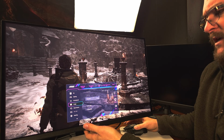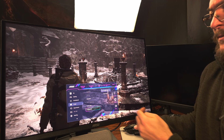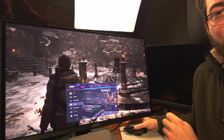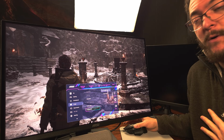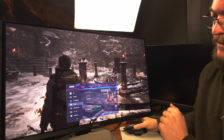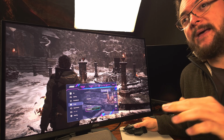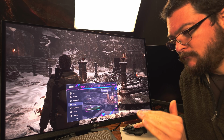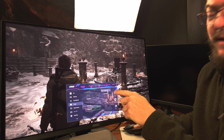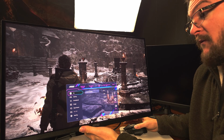Let's see what other changes we have here. On HDR, so on image display HDR, we still have the same True Black 400, which is the one I would recommend for this monitor for the most part. And we have peak 1000 nits. But based on the firmware update, in fact, they improved the EOTF tracking, which is something I cannot confirm.